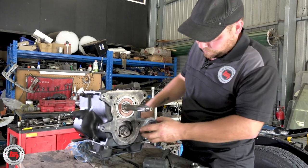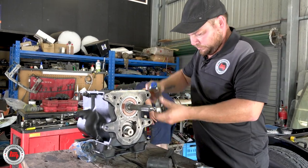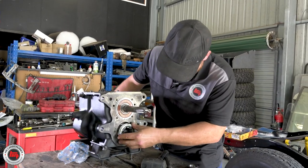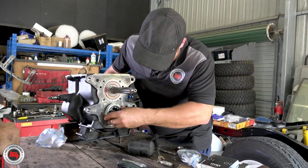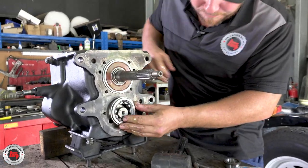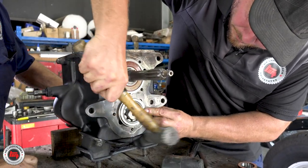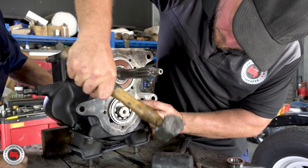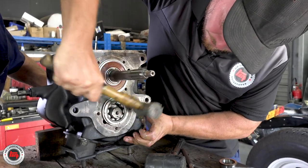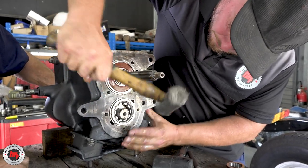It's quite awkward to get the gears all meshed and get it up and pop that in. When it's awkward, you just get a bigger nylon hammer. And who's giving you a hand in the background? That's Mick — he's a gearbox specialist by trade, very handy to have around. You had to hold the shaft up to get the bearings in. Obviously, heaps of oil on everything. There's the big back bearing. This is really quite an integral part of the build — you're making sure the gears are up. If any of these gears are touching and you hit the wrong part, you'll knock a tooth off. Good to have two eyes looking at it front and back.